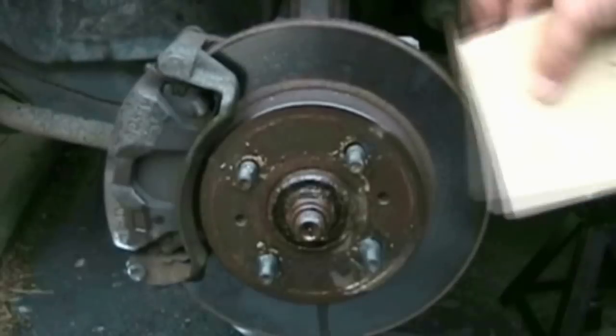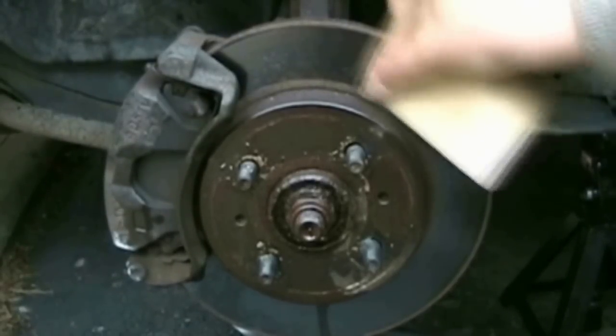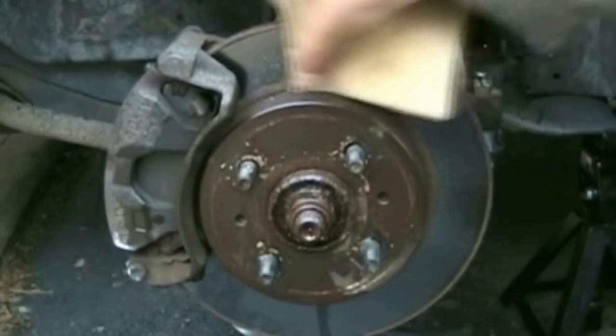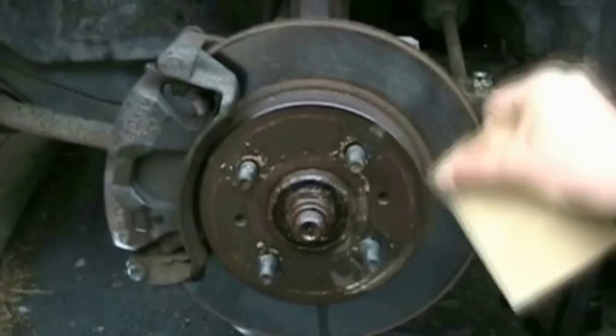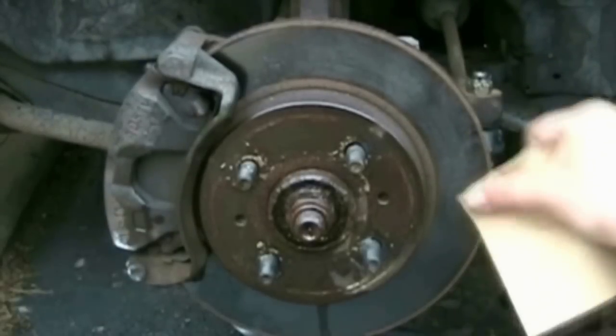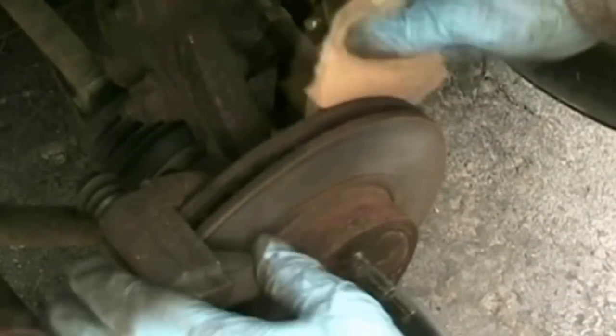The quickest way to cure your glazed brake problem is to take off your wheel and sand your rotor. Sand it all the way around on both sides. What you're trying to do is scrub away that shiny slick appearance from the surface of the rotor. Make sure as you're doing this that your vehicle is safely resting on jack stands and your emergency brake is on.